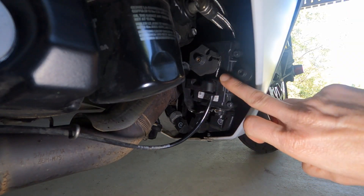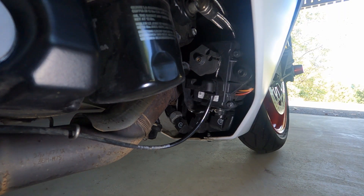So this is the exhaust valve servo motor up in there. Exhaust valves, from the very limited research I've done on this, can serve the purpose potentially of providing some back pressure at lower revs, which I think helps to increase torque, or they can just serve the purpose of reducing noise at specific parts of the rev range to meet noise restriction standards. In this Ducati, it seems it's more about restricting noise, but that's not really why I'm installing this exhaust valve servo eliminator.